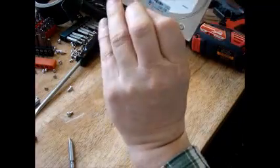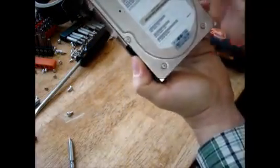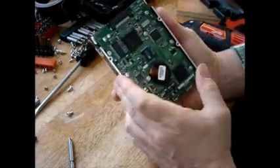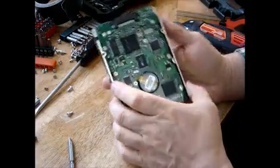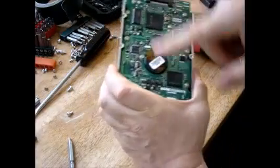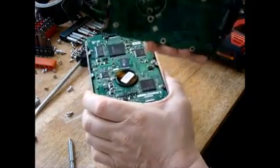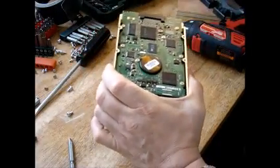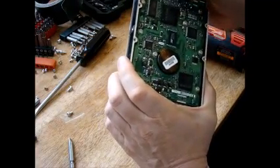Alright, so pull the disk drive out, throw away the canister. Now you've got two sides here. You've got the circuit board side and the disk side. Now the circuit board controls the drive, and this is a good source of gold and silver. So save all these, and I've already taken a few apart, so save all these and you can scrap those for gold and silver recovery also.